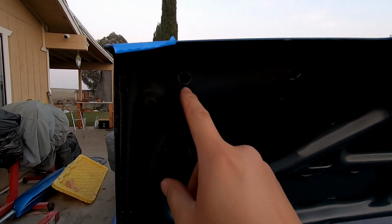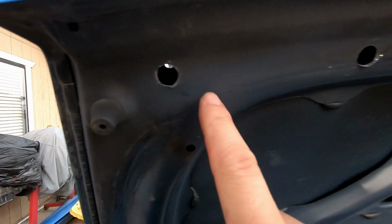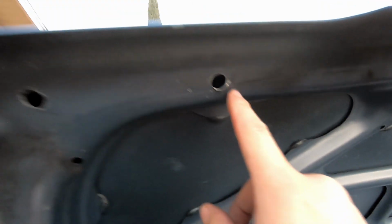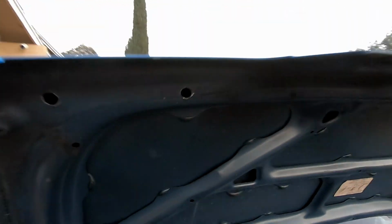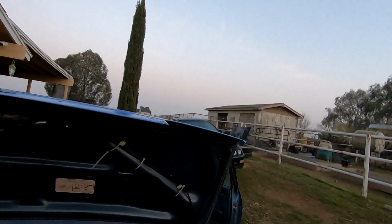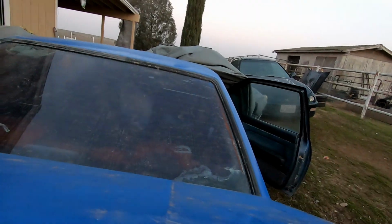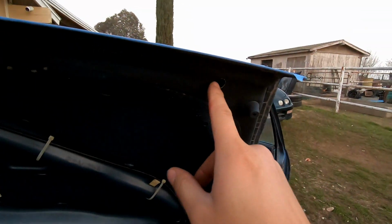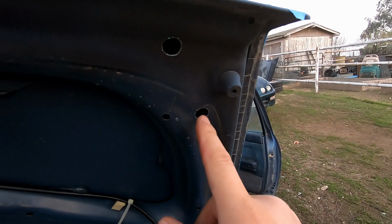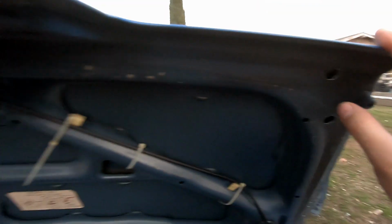So here are the holes for the other side, and these holes look massive, but they need to be this size so I can actually fit a nut through this side. And thankfully we only had to do 4 of them, because that would suck if we had to do more. Yeah, we'll see if I can mount this on there now. After that, we'll clean out the edges, deburr it because it's pretty sharp, and then maybe spray some primer on it just so it doesn't start rusting.